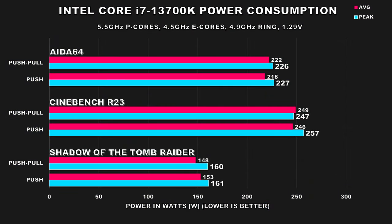When we take a look at power consumption, in all-core workloads like Cinebench R23 and AIDA64, the CPU alone is pulling anywhere from 220 to 250 watts of power. That is a lot of heat the cooler has to dissipate, so when you see Raptor Lake CPUs running at 90 degrees Celsius under these workloads, it should not come as a surprise. The cooler itself is just being saturated with so much heat that adding extra fans isn't the solution here. I'm hoping that for the next iteration of desktop CPUs, efficiency and power consumption is an area that Intel really focuses on.